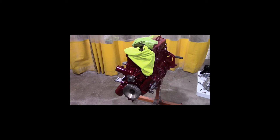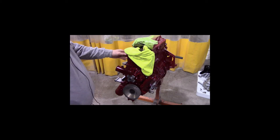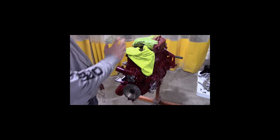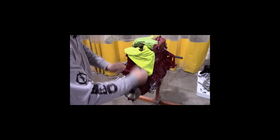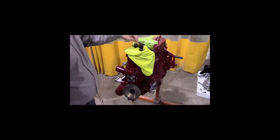Here at New Vintage, sometimes we get an engine that is supposedly rebuilt. We found this engine was leaking, so we decided to pull the head off and replace the head gasket. It looked like it had the wrong gasket on it. We got it back together, painted it, and I was messing around with the crank adjusting the timing. I noticed the crank would turn a good quarter length and this pulley wouldn't move at all.